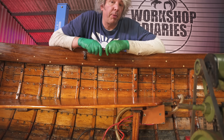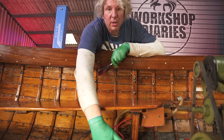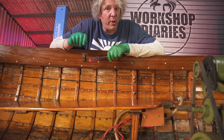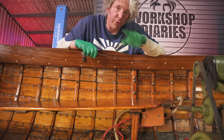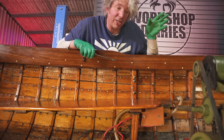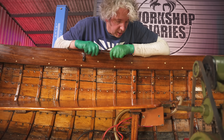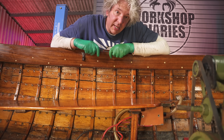So now we've definitely got our points gap OK and we know our spark plug is OK, the next thing we need to do is actually wire up the coil and then see if we actually get a spark when we spin over the engine. Obviously to get our spark we're going to need some voltage and that's going to come from our battery, which normally sits on the floorboards just under the seat. But we're also going to need a way of actually turning on that battery and making the connection to the coil. Unfortunately Martin, the previous owner, has actually managed to lose the keys. So I have to get round that just to see if we can get this engine to start, and because all of that gubbins is in here, I'm actually going to lift up this seat to give me a bit more access.